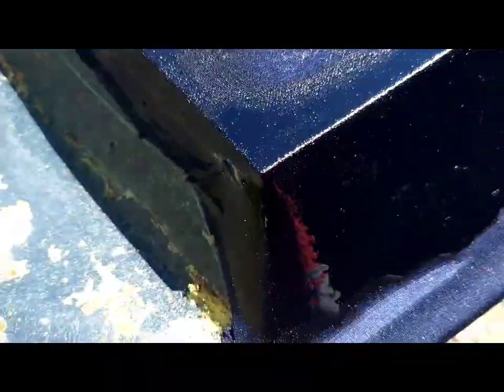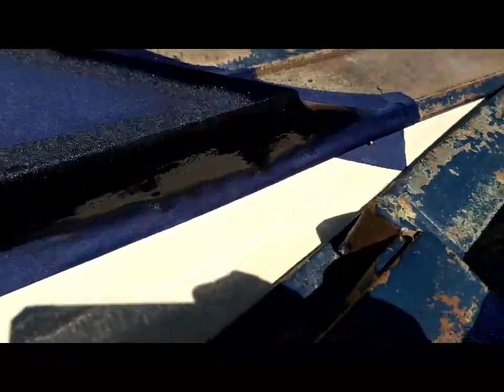So this is what happened. Since I stapled around the edges, look at that, it lifted all the way up right there. I don't know if you can see. So I stopped. What I'm gonna do on this one, I just fiberglass down to the edge right there. I'm gonna go back around and staple it before I fiberglass the edge. But I just did it around to the edge right there, just to get it hard in the form. And then I go back around with a stapler, staple the rest of that down before I put some more resin in. But this is what happened. I guess because it got so hot, there was glue under there released, so it bubbled up all right here. Look, and that's supposed to be pushed all the way back.